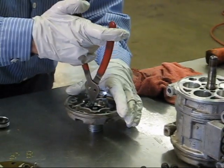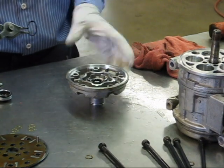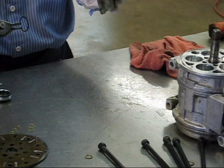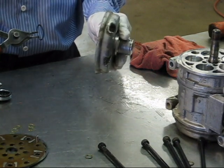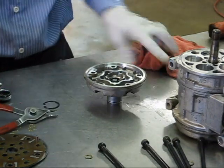The 10PA series as well as many of the GMs use a one-piece lip seal. They are installed in the case of Nippondenso from behind the cylinder head, so the compressor does need to be disassembled. Early Nippondensos as well as some General Motors will come out through the front, in which case you do not need to reseal the entire compressor.